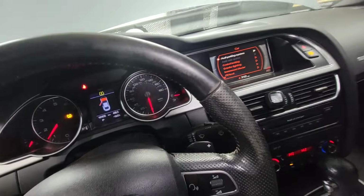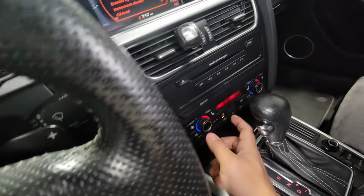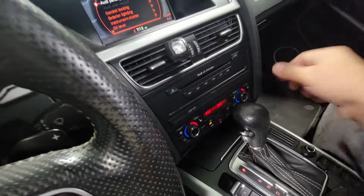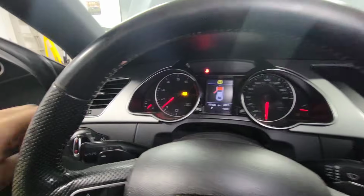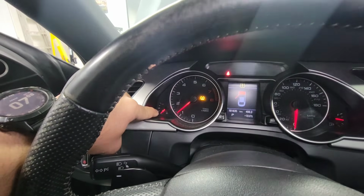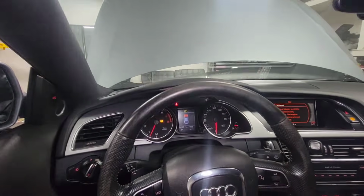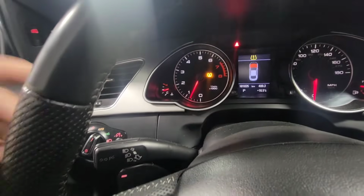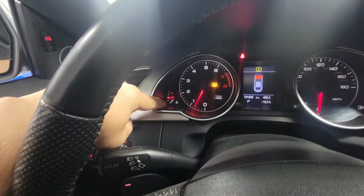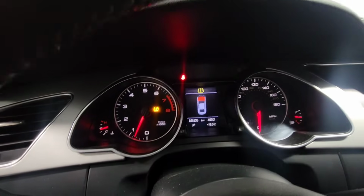Now we're gonna start the engine and warm it up. Right after you start up the engine, make sure to get the heater to the warm position, defrost, max it to heat high, and now we have to wait for the engine to reach maximum operating temperature. All right, guys, so let it idle for a bit. It's been sitting for about 15 minutes now. You can see the temperature is below half. Let the RPM up to 2000 RPM, steady for like 3 minutes.